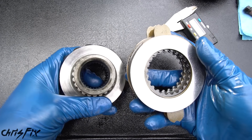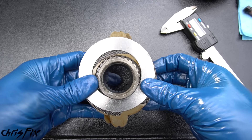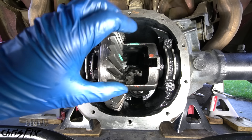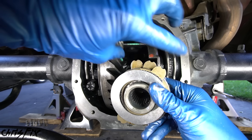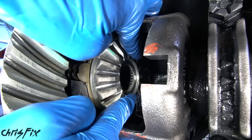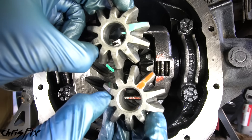All we have to do is get the side gear, make sure our thin washer is on the outside, and wiggle it right into place. Our driver's side clutch pack is done. For the passenger side it's the same exact process — get the new clutch pack on there and we're ready to install these in the diff. Back at the differential, installation is opposite of removal. Grab your driver's side side gear — you see these clutch ears? We want those to be aligned, so straighten them out and slide that side gear into place. Now do the same for the passenger side.